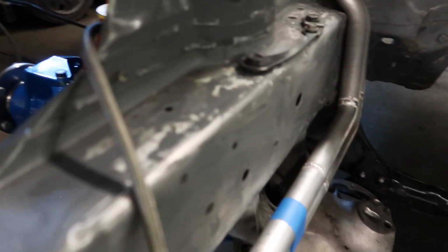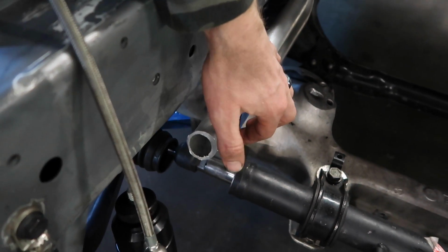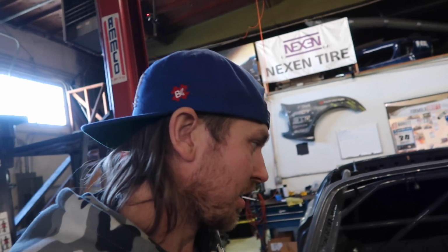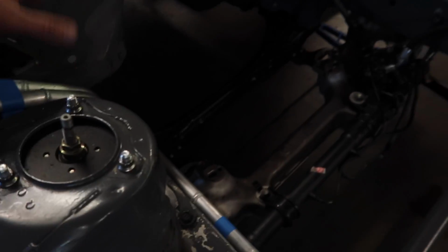We're gonna put a thermostat on this one, but we need the other flange that'll go on here, which we wanted to weld on a -16 ORB female. That's a -16 female on both of those. So we wanted to weld one of those on. We don't have any in stock right now, so we'll get one of those from XRP, and maybe like Tuesday night we'll start working on this again and finalize that.